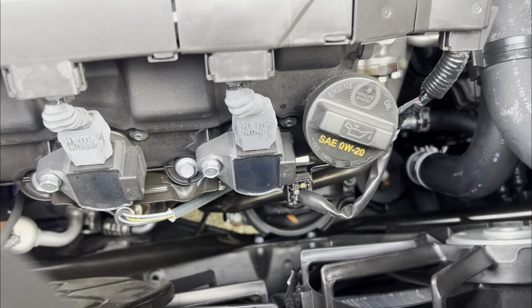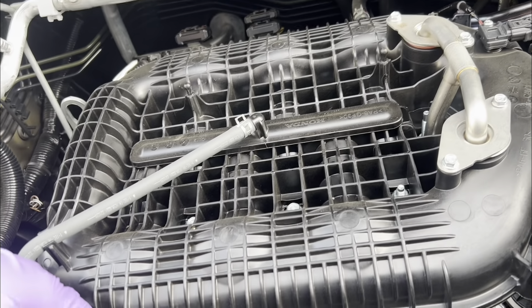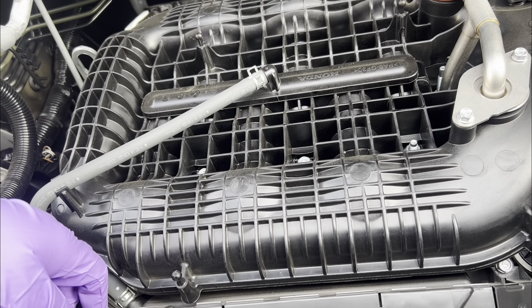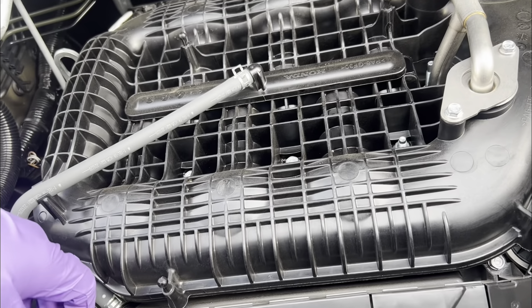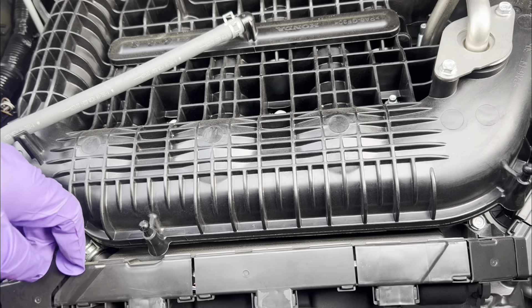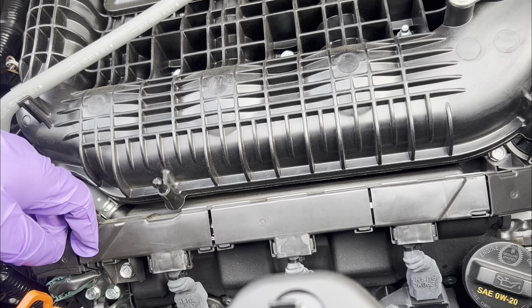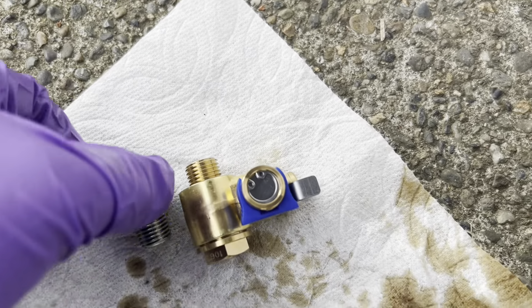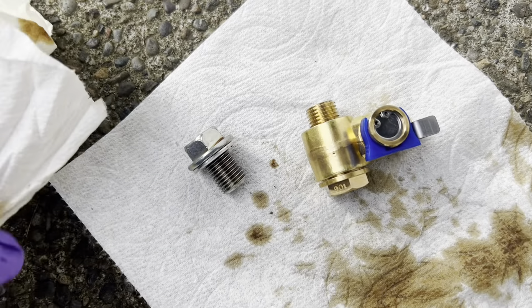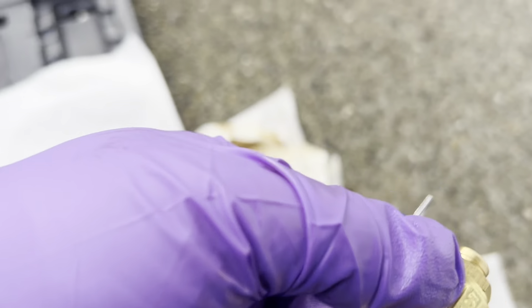To get access in here, I just cranked the wheel to the right and then you see that little blue thing right there — that's the oil filter. I'm just going to reach in there. I do have a wrench I might use to loosen it, but I'm going to hand-tighten it only — I'm not going to use a wrench to tighten it. That's it — probably five to six quarts.